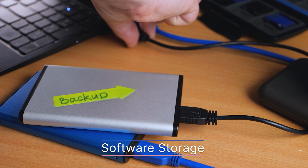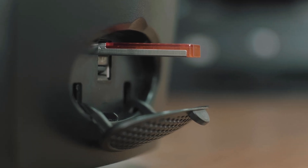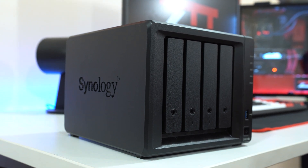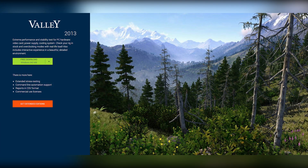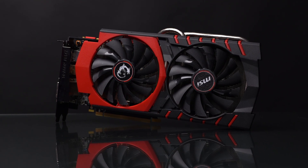Before wrapping up, here are a couple of extra quick tips to streamline this process. First, if you can spare an extra external flash drive, put all of the stress test software on there so you're not wasting time tracking down and downloading software for each and every build. Bonus points if you have a NAS or network attached storage device set up, so you can quickly access those files from anywhere on your network. Second, there's a ton of other stress testing software options out there — software like Prime95, AIDA64, FurMark, PCMark, and Valley are all super popular as well. Use my list as a guide to get started, but feel free to build upon it depending on what works best for your situation.